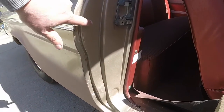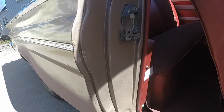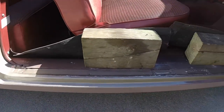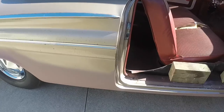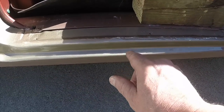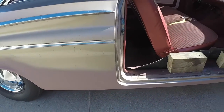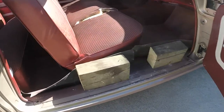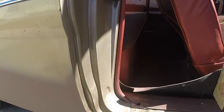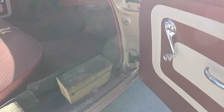Well I don't think it's going to get any better of a match than that. There's a little bit — you can see where that's the paint line. I'll just rub that out with my finger with some rubbing compound once the paint's dry and you won't see that. It came out pretty good. I'll let that dry two or three days so I can mask on that to paint this out here, and I don't want to pull that up when I mask it. I'll leave the door open for a few days too. I have the battery disconnected right now so the dome light doesn't stay on. It's 64 degrees out so I'm just going to leave the car outside to dry. The air circulation will help evaporate the reducers quicker and dry it a little quicker.